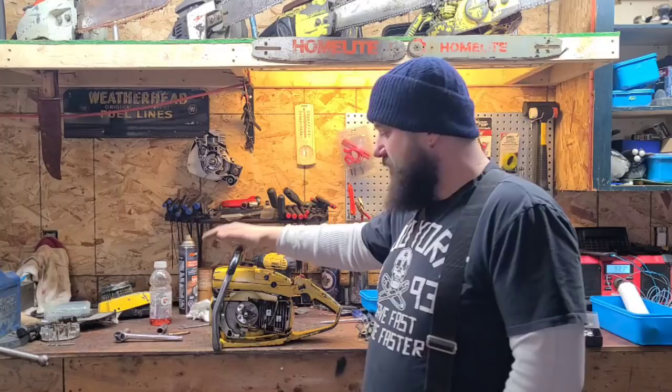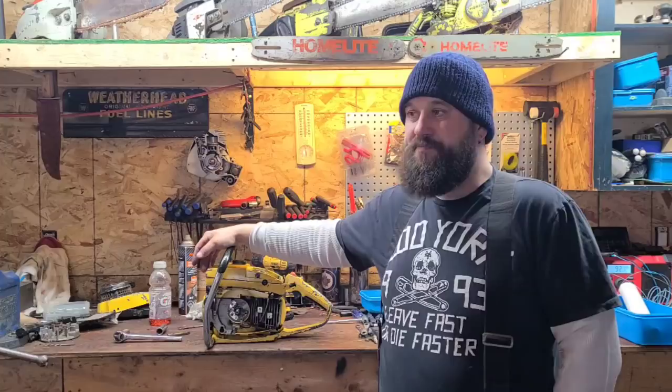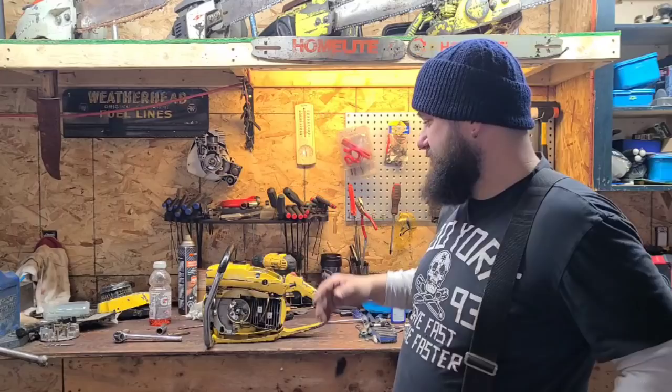Well, you guys saw I vacuum pressure tested it. You can hear the saw's a little slow to get back down to idle. Now, I've talked to a lot of you guys. McCulloch's tend to run like that, a lot of them. Big heavy clutch, big heavy crank, and a heavy flywheel. That might just be how this saw runs. It's not lean. The plug looks golden brown. That's just how these run. I'm going to try and get rid of that, but we don't know.